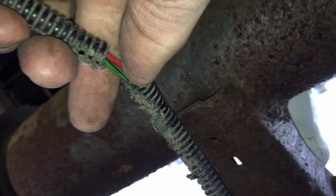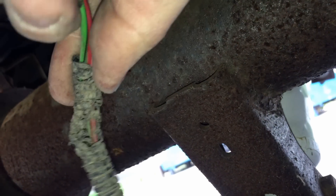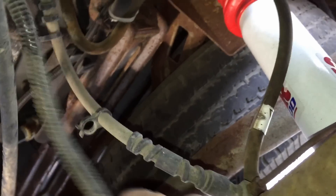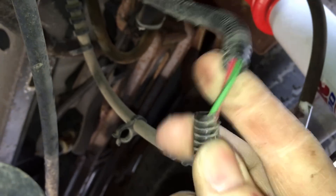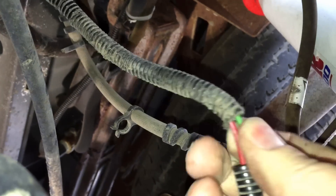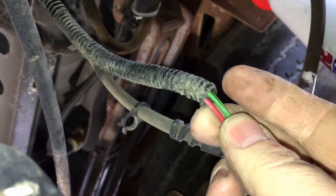Before just changing the sensor — and this particular one I've opened up and I don't see anything, the wire looks good — you can feel by flexing it if it's too hard, which usually indicates corrosion inside. You want to pull the sheathing back wherever there's damage and get a good look in there. On this one going up here, there was another break, so I'm pulling back the conduit to look at it a little better.